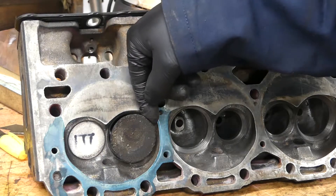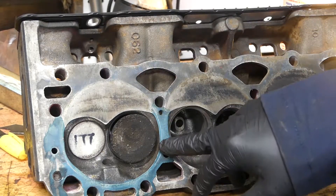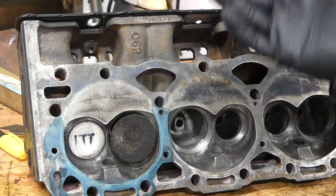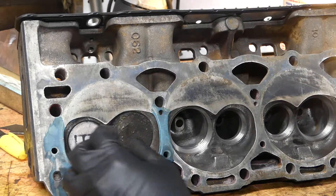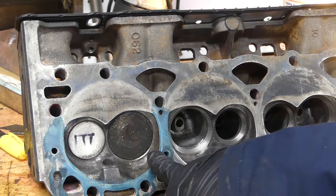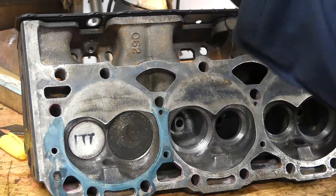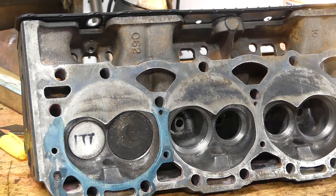The more room you have to unshroud the valve all the way around, the better the airflow. You don't want to cut too much though, because if you do you end up affecting your head gasket sealing, get too close to your water jackets, and that can cause cracks in the future. So I'll keep these old valves in here as a safety net so that I don't accidentally touch the seat with the carbide cutter — touching the seat will wreck it. These are garbage valves just sitting in place to protect the seats.